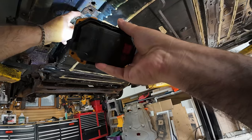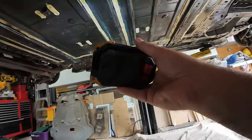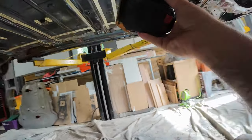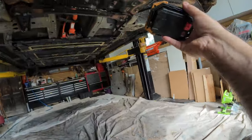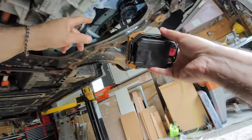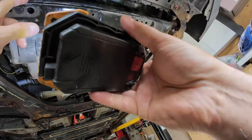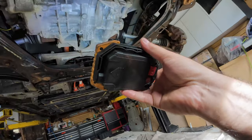This is part of the main structure that carries the battery. You definitely want to run these with your tools and spray product all the way through the bottom of this. The battery has a space in behind this steel case. Coming up to the subframe, this is all normally protected, but you can see there's a fair bit of rust coming around here. It's a pretty important piece — the main support structure for your suspension and motor. You want to make sure you run all these. There are holes you can get into and spray. I'll coat this on the outside; I've sprayed all the inside with the 700 and will hit it with the 300.